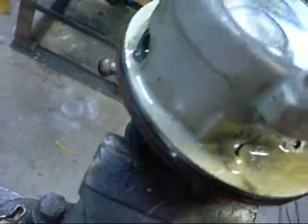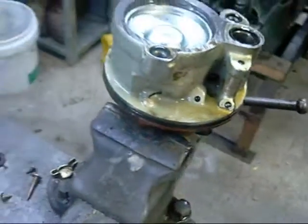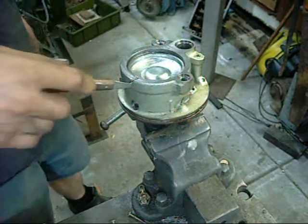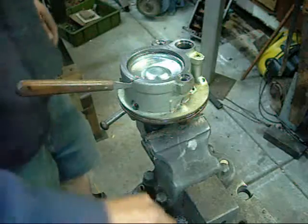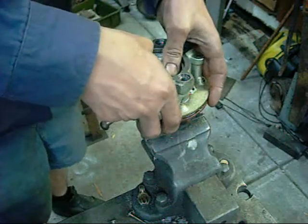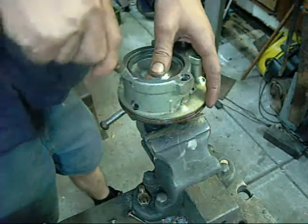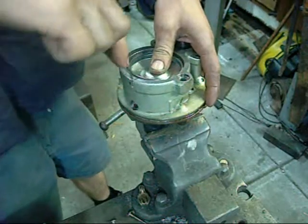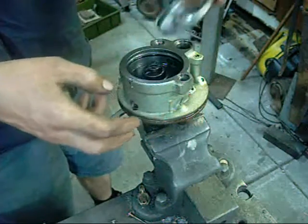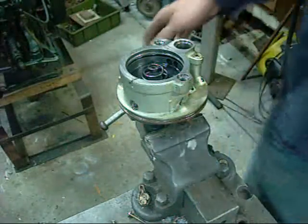I'll try and get that big Welsh plug out — looks like it's just retained by a spring clip. I ended up cutting this clip in half with the four-inch grinder. Pretty hard stuff; there's no relief groove in it to actually pry it out. I think it's under a bit of spring tension — that's really going to fly out when I take the clip out.